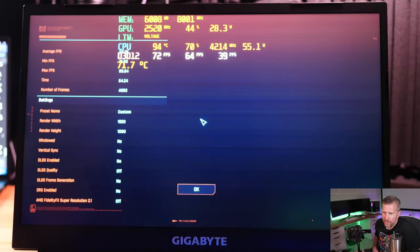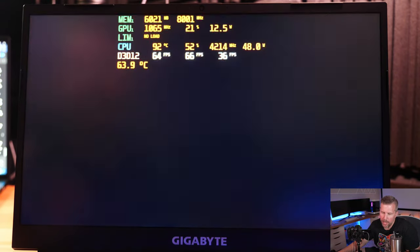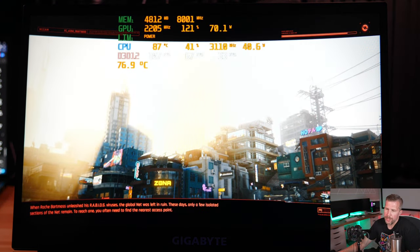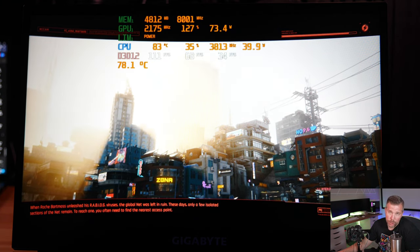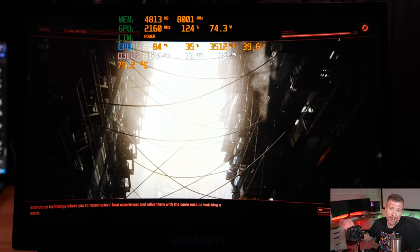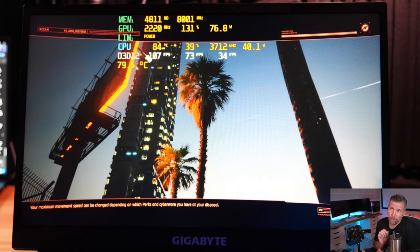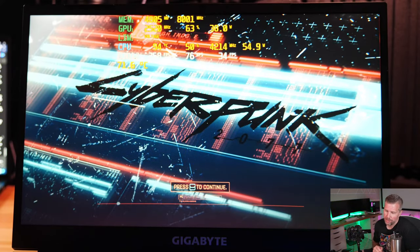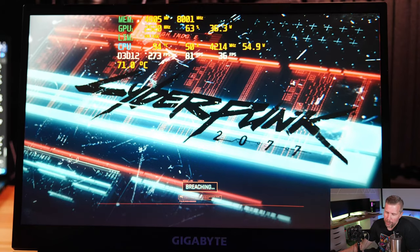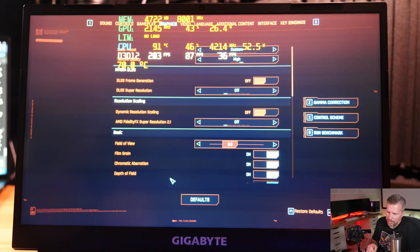We did 63.56. We are obviously running very high temps in this machine. You could tame them down with your own power limits, and you could also get a laptop cooler to help keep these temperatures in check a bit better. Repasting the CPU and GPU on this machine would also probably help a lot. That would probably be the number one thing I would do for this laptop.